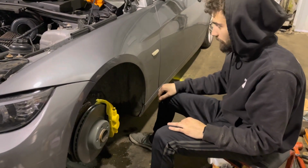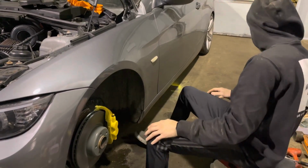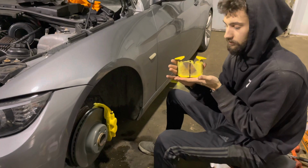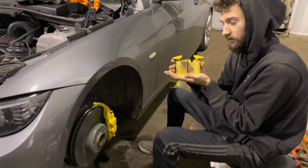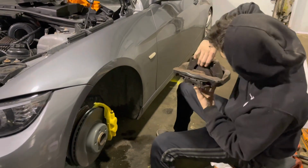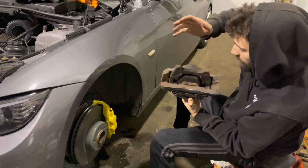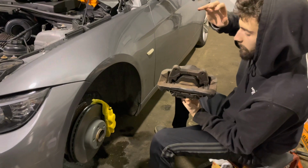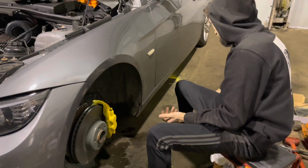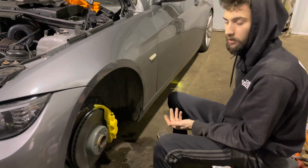So yeah, this whole upgrade will cost you probably like $500. I consider it an upgrade. You get better pad displacement because you get one fat square piece of pad, that is not yellow, but this one is. That looks like this. This is your OEM, which is about the same, but you're losing all the angular space on the bottom. It's probably just a bullshit upgrade, but in all honesty, it did reduce this corner weight by 2 pounds, which isn't a lot, but 4 pounds of total unsprung weight is quite a bit that you can feel sometimes when you drive cars.